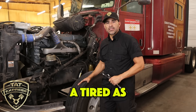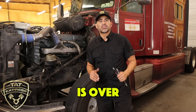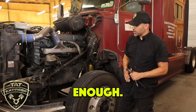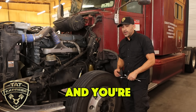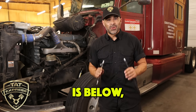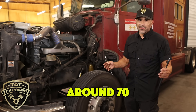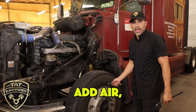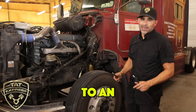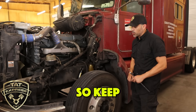If you have a tire that has low air pressure and you need to add air, make sure your supply is over a hundred PSI — usually around 110 to 120 PSI should be enough. Make sure when you're hooking up and adding air, you're going to be using a chuck just like this. If your air supply is below what the tire needs — say your air supply is around 70 PSI and you try to add air — you're actually going to be removing air from the tire. Keep that in mind.